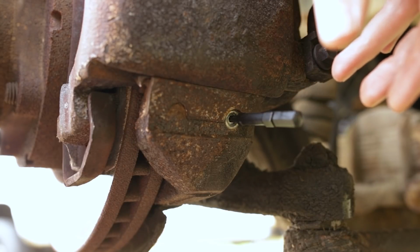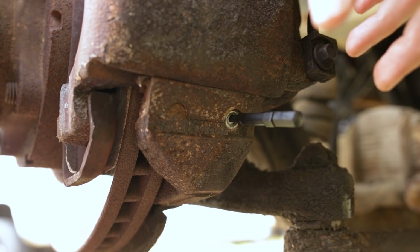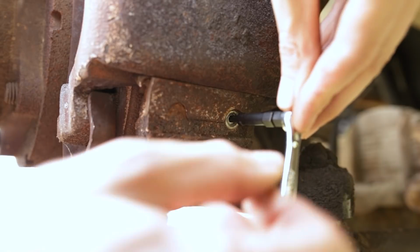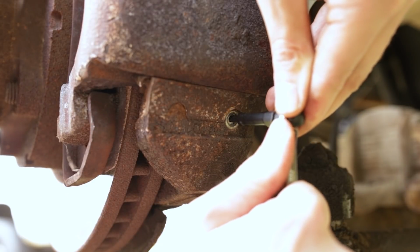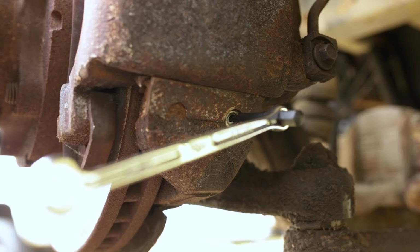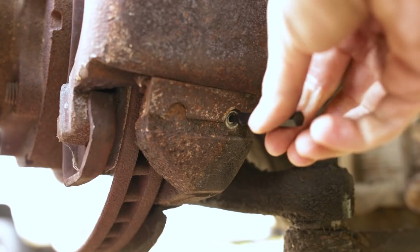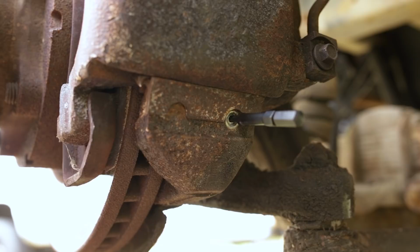And I believe we're using a 9/32 wrench. No, 5/16. So hopefully we got enough meat in there now. We can get this to start wanting to turn out. Again, don't want to break off the extractor in there, so I think I'm gonna go run and get the torch and put some heat in this to persuade it to come out.